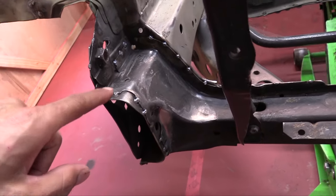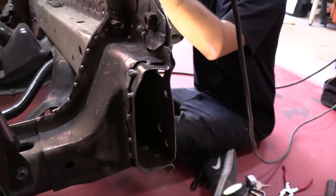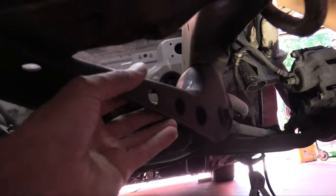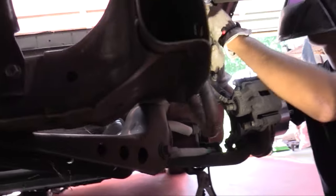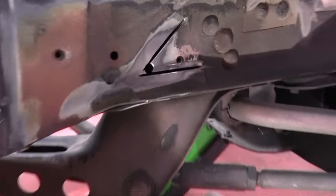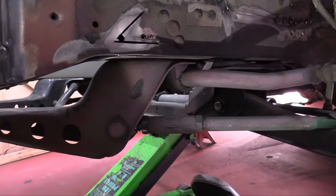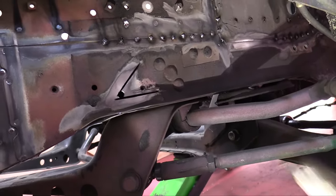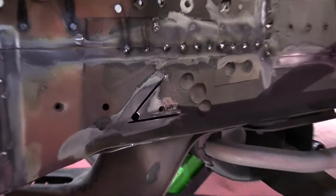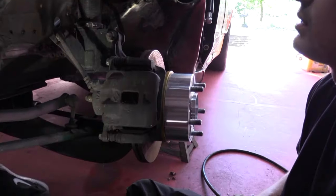This is a super critical piece to spot weld, because when you drift these super old cars, this comes apart and then your whole tension rod bracket will move back and forth while you're driving, and that is never good. And what happened here, dude? This? Yeah. The bolt that holds this in comes loose after a while. Probably a couple crashes, but yeah. I had to cut this open to re-put a nut and bolt on it at the track. That's another pretty janky, common old S chassis problem. You got a spacer, dude.